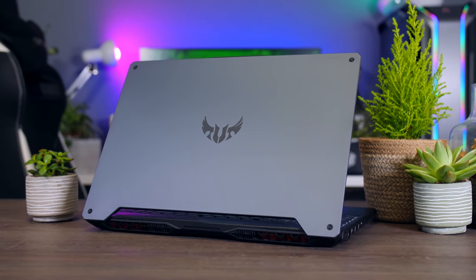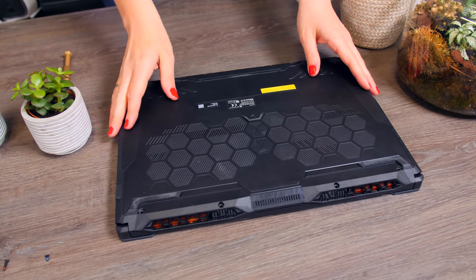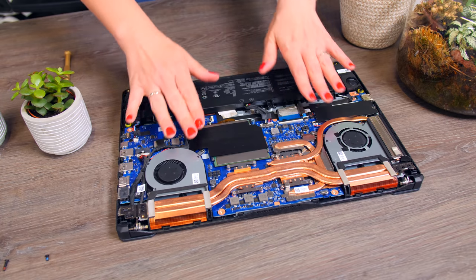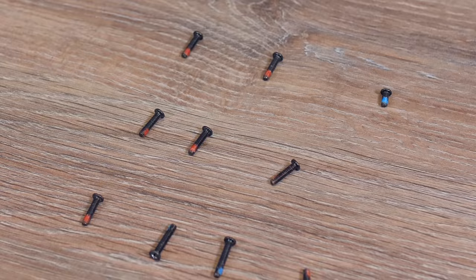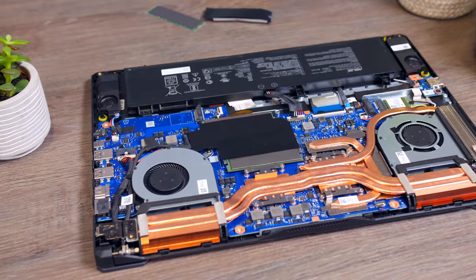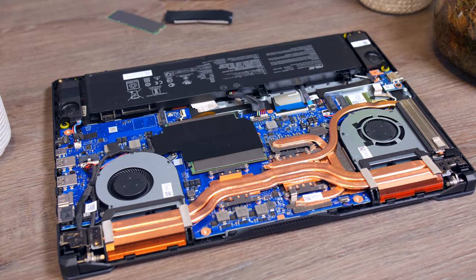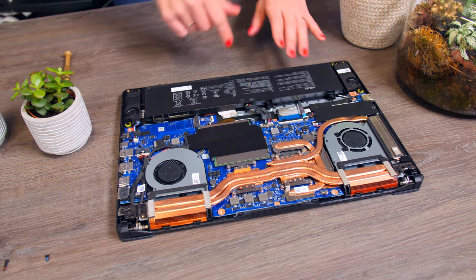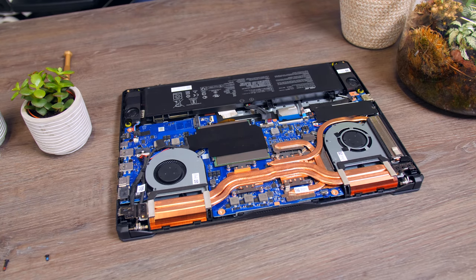This is within spec but I can't help feeling a bit uncomfortable when CPU temps pass 90 degrees Celsius. The laptop doesn't really feel hot to the touch, but you can feel hot air blowing out the back and right side. Opening the laptop is not hard — only a couple of screws stand in the way of cleaning the fans, replacing the memory sticks, or adding a second NVMe SSD. They do use different sizes of screws so you need to keep track of which goes where. There also appears to be space for an even larger battery, and 48Wh models gain a slot for a 2.5-inch drive.